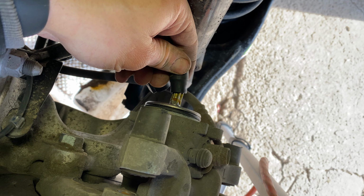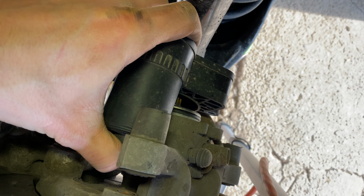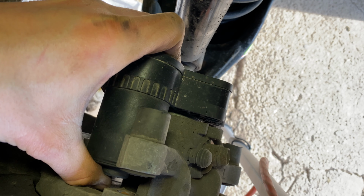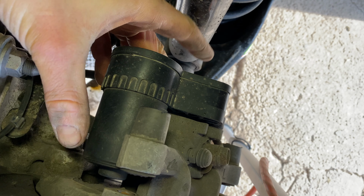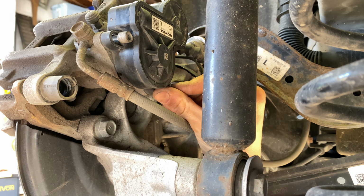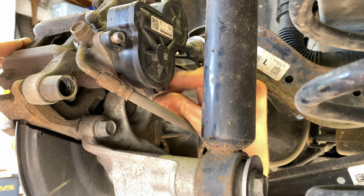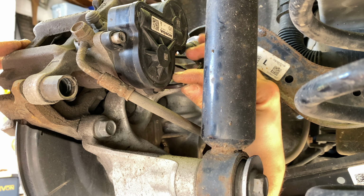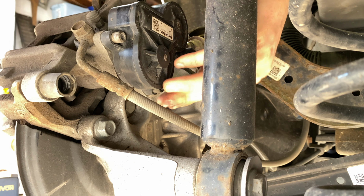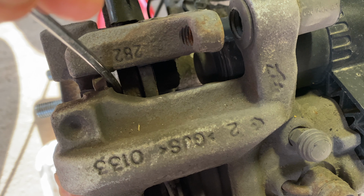You may need to slightly turn the actuator back to remount the parking brake to the assembly. To avoid contamination of this closed system, I strongly recommend lining up the splines to the actuator and reinstalling following a complete winding of this mechanism. After applying some thread locker to the number 5 Allen bolts, reinsert them into the actuator and brake assembly. Do not over-tighten. This is plastic and will break. There are no torque specifications given for these, so make these hand tight and the thread locker will handle the rest.